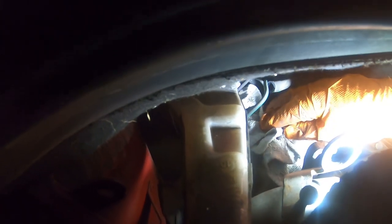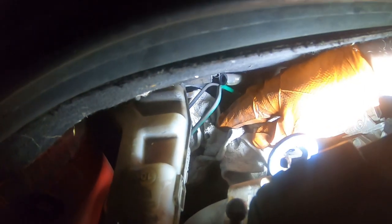And then I've got to pull this hose out there. So try to minimise fluid spillage, because brake fluid makes for a good paint stripper, which is what I should have used, wouldn't I? So I've got a suitable rag. This is just a push fit, so give it a good pull. And that's that out. So we don't seem to have lost much fluid, so that's not entirely a bad thing.